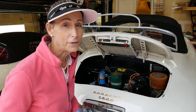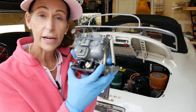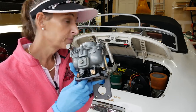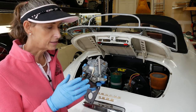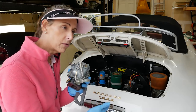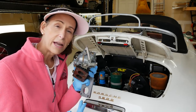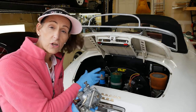It's a couple of days later and the weather has changed — it's kind of cold out, in the 40s. We have our carburetor all done and ready to go — the left one at least. I painted the base and cleaned everything up really well. I want to get this one installed before I take the right one off. The reason I do that is this car has a mechanical fuel pump, so it takes forever to fill up the bowls on the carburetors. If I pull both at the same time, I've got to crank and crank to fill both of them. But if I leave one on, I can start the car on the right side at least, fill this one up, and when we hear all four cylinders going we're good to go. Then I can shut the engine off and get to the right carburetor.